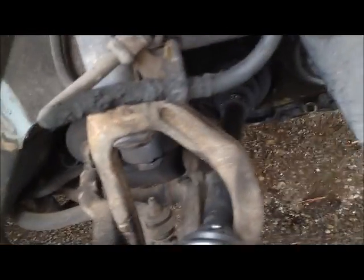Just wanted you guys to see the progress that we've made so far. As you can see, I've already got it to start lifting up out of the hub assembly. And also, if you notice up here, I had my brake caliper hanging over on this side. I was kind of rushing to get it all finished back together before Monday morning when I go to work. So I was actually stretching out this brake line a little too much, so I ended up cutting the zip tie and hanging it off to the other side. So just be careful to not put a lot of strain on this brake line. There's the empty space. There's what it used to be.